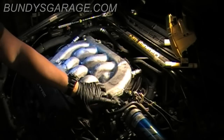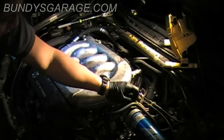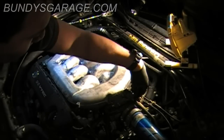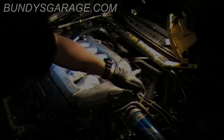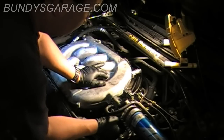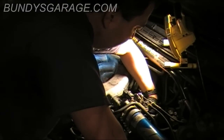The next thing you'll do is to button up the throttle body here. Two studs on the top, two bolts on the bottom. Go ahead and reconnect this connector here. And let's put those back on. Start that by hand. Start the one over here by hand. That one is still down there because I couldn't get it out, so still in place back there, hopefully. That one started, and reach here on the back side. Yep, that one's still there.